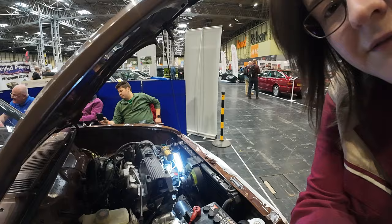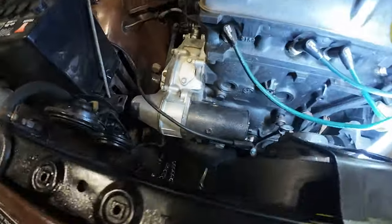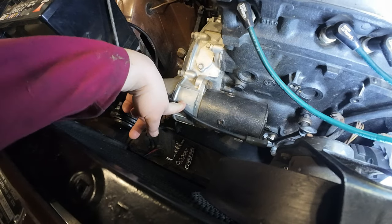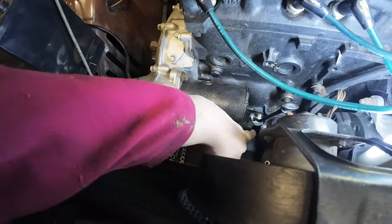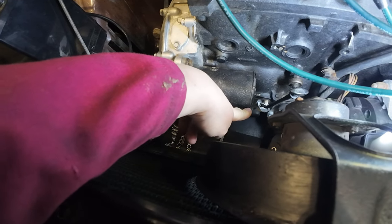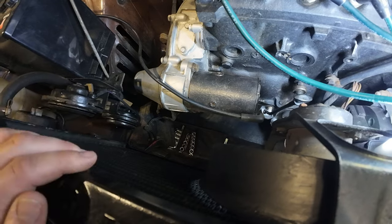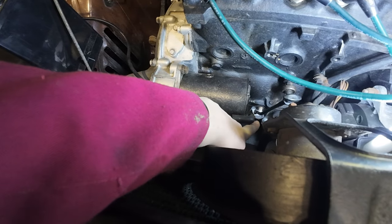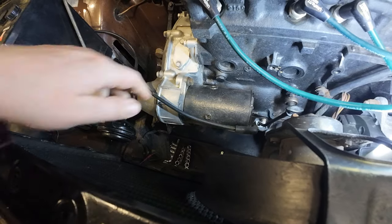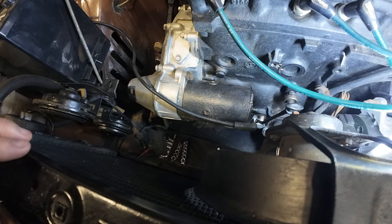If I show you, there's literally two bolts to the housing here, and then one bolt here, or one nut, shall I say, just to take the live cable off. Excellent. And thankfully, that's not live, because that's only live when the solenoid makes it live, so we don't have to worry about isolating the battery on this occasion.